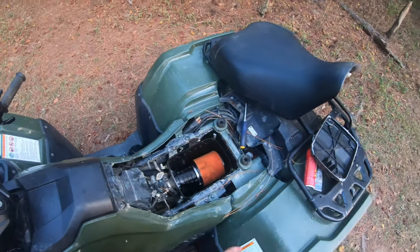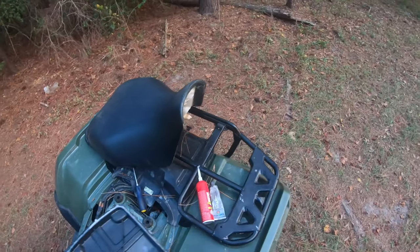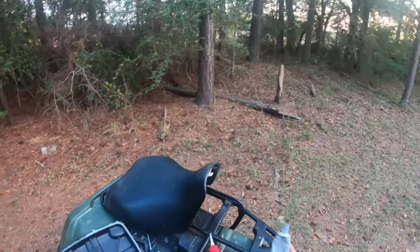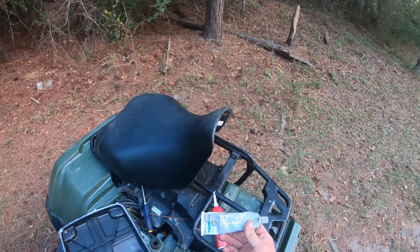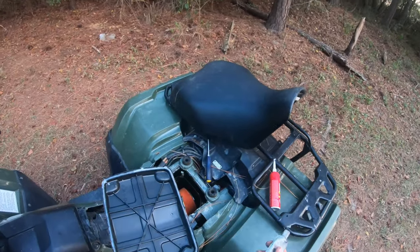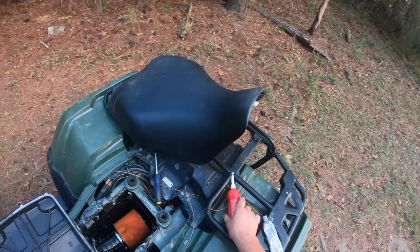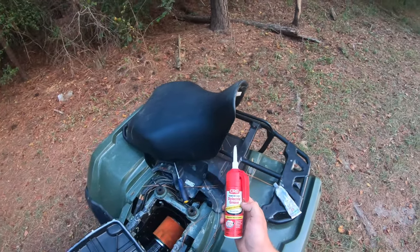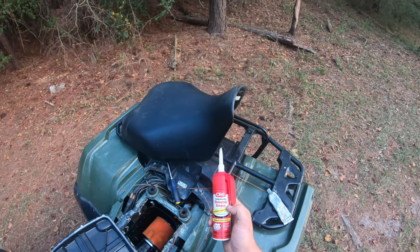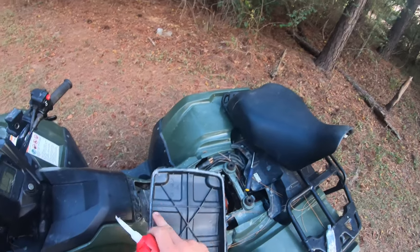Alright, so there's one thing I really wanted to stress today, and you can probably tell from the title of this video, but please, please, please do not ever use silicone, gasket maker, whatever you want to call it, on your airbox lid. Please just use some dielectric grease. I really like this, I got it from O'Reilly's. The CRC technician grade dielectric grease with this little handle and nozzle. I really like it because I can squirt a bead, kind of like I already have.